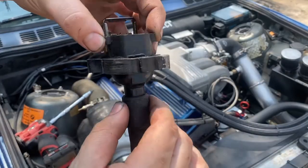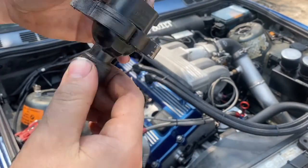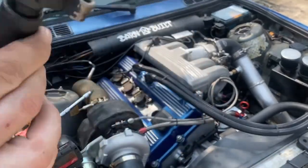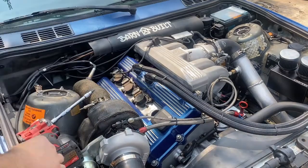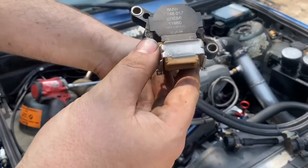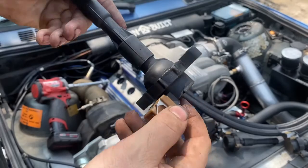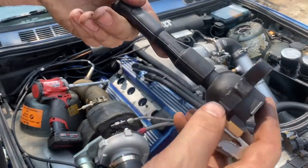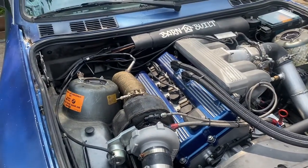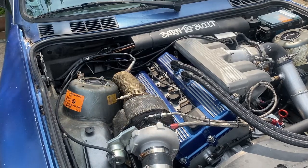See how these coils are cracking apart? They're not Bosch — they're probably Chinese. I personally wouldn't run these, but we'll see if we can find some type of solution here. I've got this one out of my M52 TU — it's original from 1999 and I've got brand new Bosch boots for it. German-made coils in there, German-made boots, even though they're old. Hopefully they do the trick — we will find out.